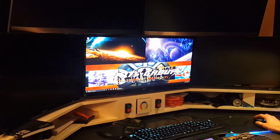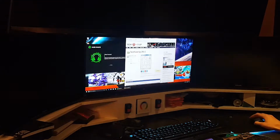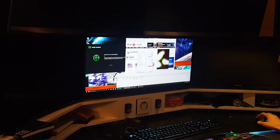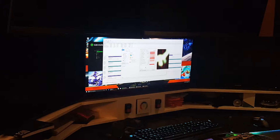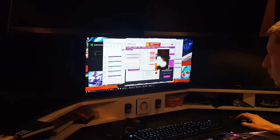When I finally got into Windows, I began to install all of my software and benchmarking tools, but first, I had to set up the hard drives via Windows Partition Manager by creating a striped array between the 4 hard drives. This gave me a total of 12 terabytes of hard drive storage. After that, I began to run my thermals and thermal monitoring software. Running stress tests, I watched how my system temperatures acted.